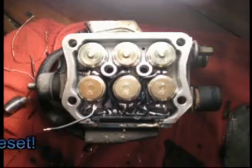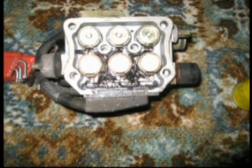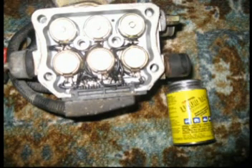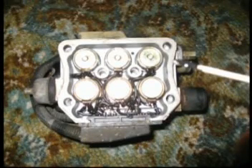You can see all the wires are done being run. I'm double-checking my connections and the continuity of the solders. Then I used this stuff called liquid tape — it's kind of like electrical tape — to make sure there are no sparks on the inside. It's really inexpensive. I applied it with the end of a toothpick so I could get into all the little nooks and crannies with that liquid tape.